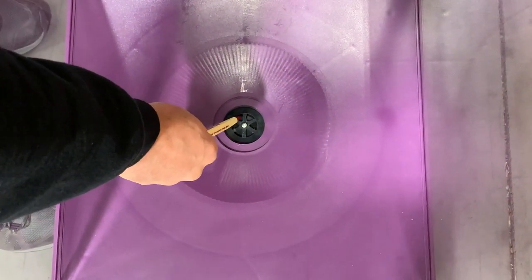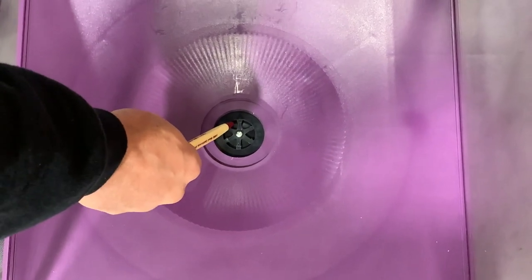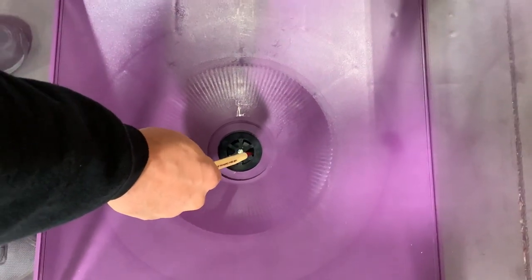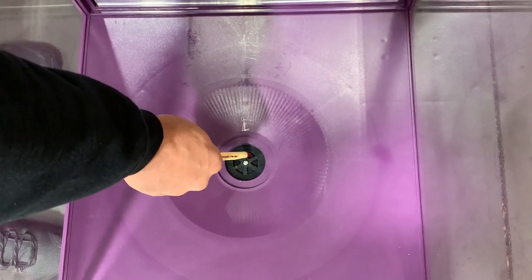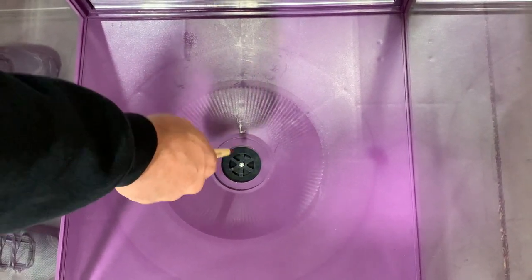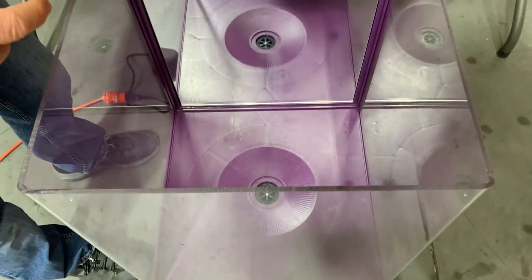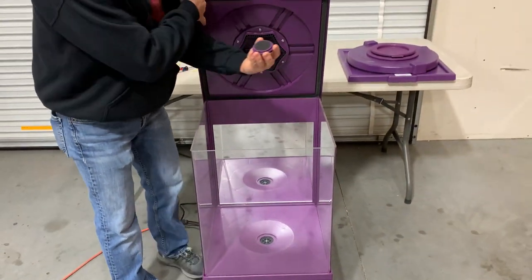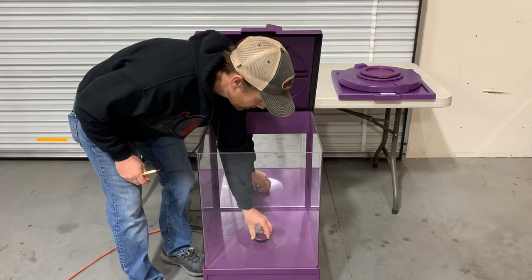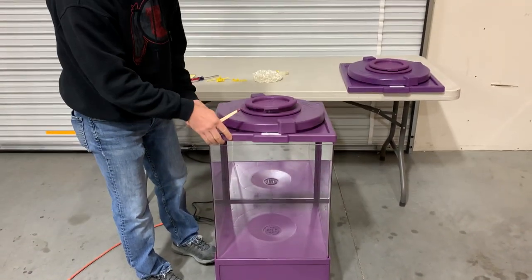You can take a pin and gently push down on the valve, and with your hand on the back of the machine, press the button to start the machine and go through each little section gently. That should clear any debris. You can also use a can of compressed air to spray that out. Then simply take the filter, put it back in place, and it should be cleared.